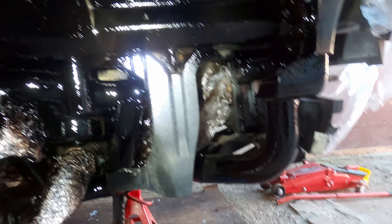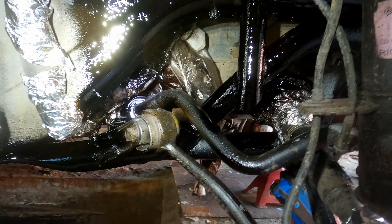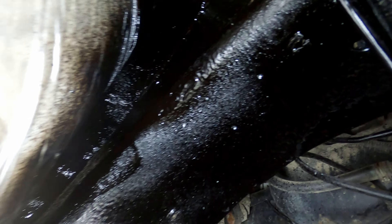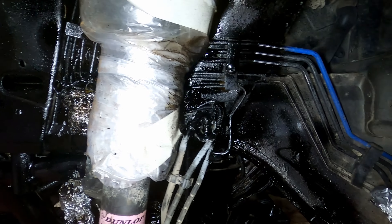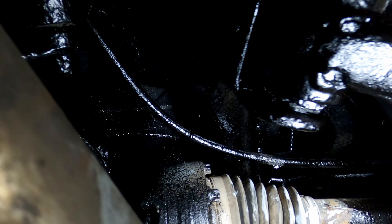It's looking shiny and new. Sure, there are still some spots I haven't painted — places I didn't quite reach — but it doesn't really matter anymore. I'll wait for it to dry and later tonight I'll come back and hit those missed spots with some more bitumen. Well, it looks like the anti-corrosion coating is finally nearing completion. After that I'll just need to put all the protective covers back on. I think I've done enough — if there are areas where I didn't spray bitumen it probably means they didn't need it.